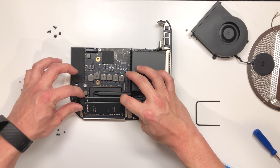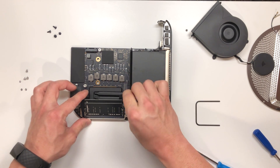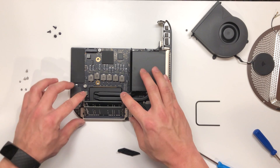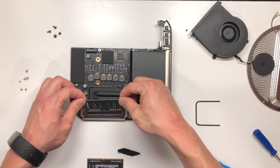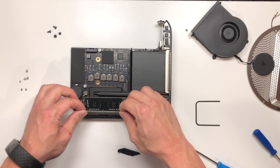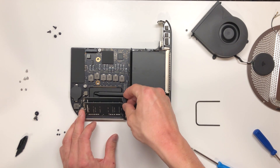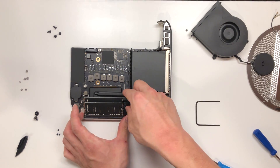There are two rubber pieces here. I'm going to remove those pieces just so you guys have a better idea of how these RAM pieces are held into place. You pop these metal tabs up and you can pull the RAM right out of the logic board. To install new RAM, simply line up the DIMMs and push it down into place, and that will lock the RAM in there. Standard four gigs and four gigs, which makes up eight gigs on the base model Mac mini. I'm not entirely sure if you need to remove this rubber piece, but it seems helpful to let you guys know how this works.